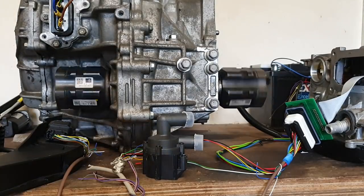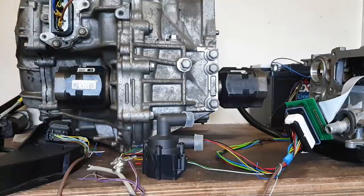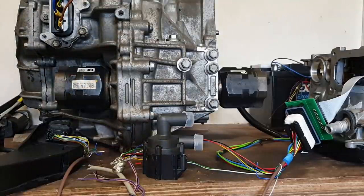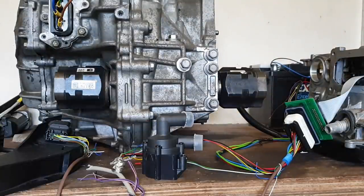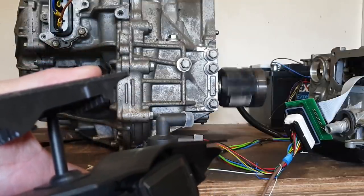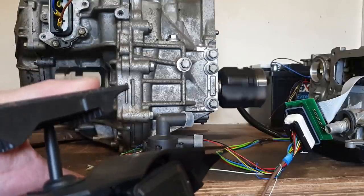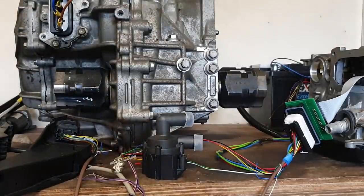So at this point, we are very, very near the bottom of our little graph. And the last thing that we want to do now is to go to our commands, stop the inverter, and save the parameters to flash. And the final test then is to put our inverter into normal run mode just by pressing the start button, or as I do, put it on the 12 volt battery terminal. Take our throttle pedal. And as we can see, we pretty much got her dialed in.